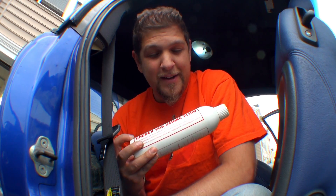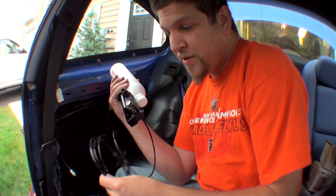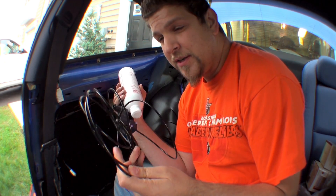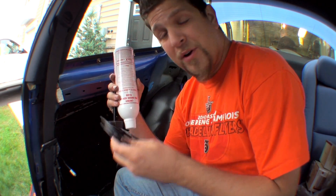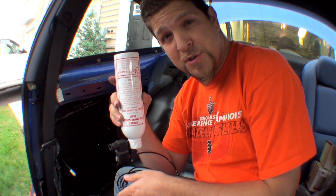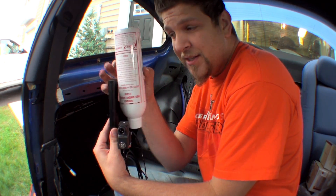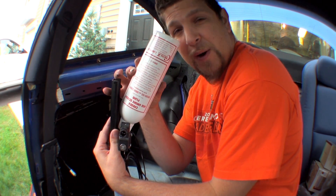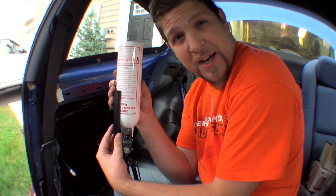It's going to be kind of cool — no one's really seen this in the US, so we're going to install it and show you what it does. One of the first steps is planning this whole thing out. You're given about this much hose, and this will go from the canister to the unit that heats the smoke up and disperses it. We want to make sure we have enough length and that it's in a safe, secure spot. You can't tilt it beyond 45 degrees — they recommend keeping it within 10 to 20 degrees — and I've found a perfect spot.